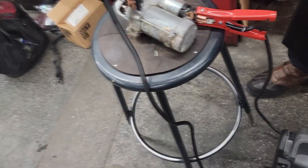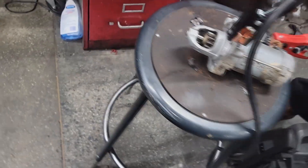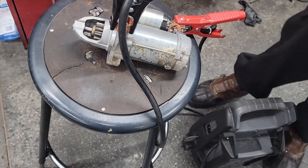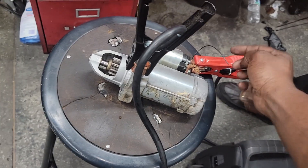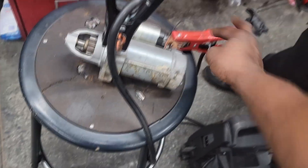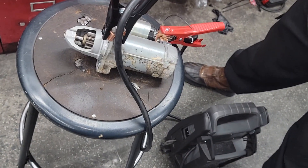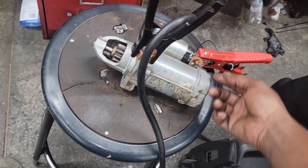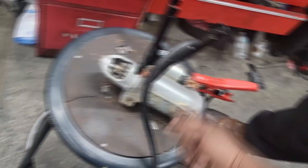This wire right here — honestly, I'm not even sure. Yeah, from the starter relay — remember what we talked about? When you turn the key, or if it's a push start, if the starter relay is working, 12 volts from the fuse box is gonna come to here. And if power supply is already here and ground is already here, the starter's supposed to start. So if you get a car with no crank, that's the best thing to go to, in my opinion — go straight to the starter relay. You can jump 12 volts straight to this thing and see if it runs.